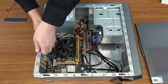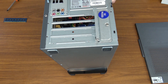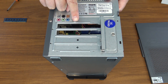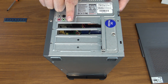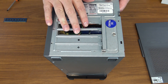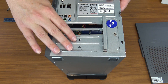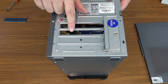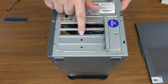Now the next thing is I'm going to lift the machine up so you can see. There are two openings already open on the back of this computer because I've already had a graphics card in here — a GTX 750 Ti. If you've never installed a card, you'll have all four of these covered. These are temporary plates attached in three points, and they were here, here, and here.